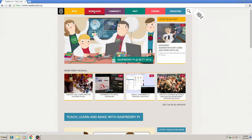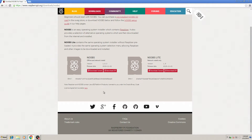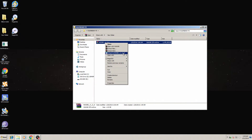At the top we're going to go to Downloads and then to NOOBS. We want to go ahead and download NOOBS. You can download the torrent or you can download the zip, depending on whether you feel safe using torrents, or you can download it directly in your browser via the zip. I have already downloaded it and placed it in a folder on my desktop named Raspberry Pi. This is NOOBS version 1.5.0 — it's 1 gig.